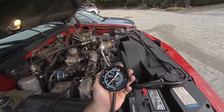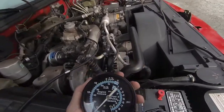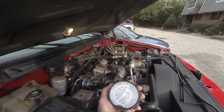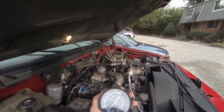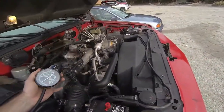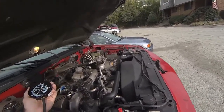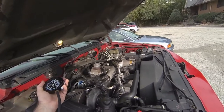Look at that — this is a very strong 24 inches of mercury at the actuator. So because I'm still getting black smoke, I'm going to rule that out and go buy a new actuator just to play it safe. I shouldn't be getting any black smoke, but when I go to full throttle for a certain period of time the black smoke just stays. I believe it should come on for a second and then disappear, but mine sticks around — that means my actuator is probably bad. There's a chance the turbo itself might be bad, but I've taken it off and checked the impeller play and there wasn't anything there — it was strong and tight. So I'm going to go buy that part and hopefully make another video.